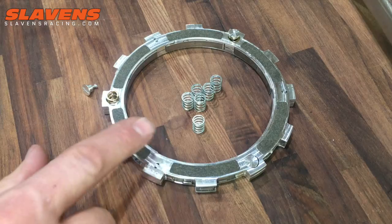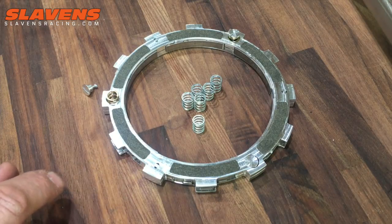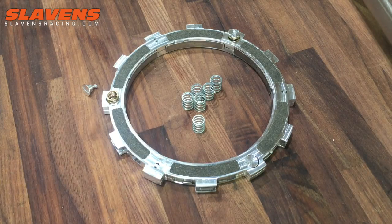And this also, not only does it stop the disengagement going down hills, but it makes them engage quicker, so it's more responsive when you hit the throttle. And that's why I like that pulse in mine. Because when I touch the throttle, I want it to go. I don't want there to be a lag period there.